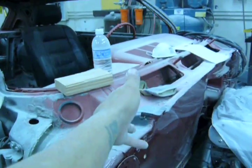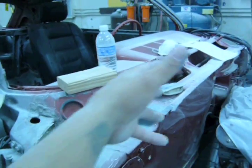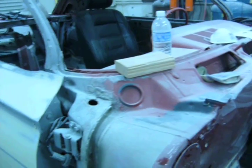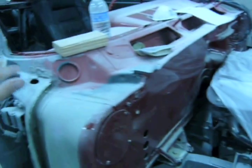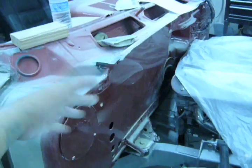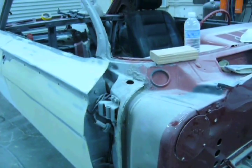Then you throw in your cowl panel and then your hood. Your cowl panel and fender might change according to how the hood fits. But yeah, I first start off with the 2 bolts right there, maybe a bolt right in the corner of the support, and everything else is loose. And you keep it loose up here because, just imagine a fender's here. The gap to the hood is right there, so you leave that loose in anticipation for the hood. More on that later.